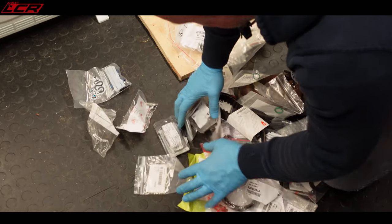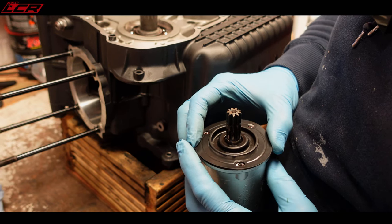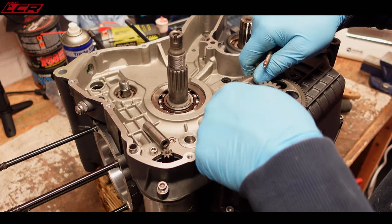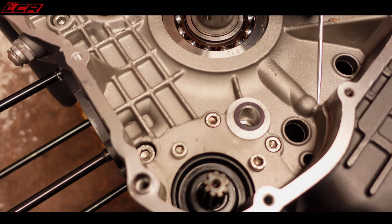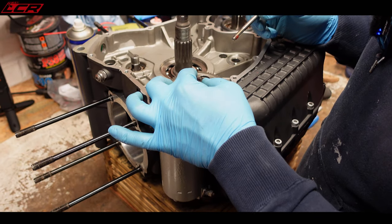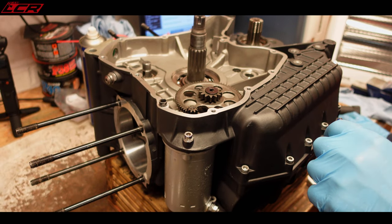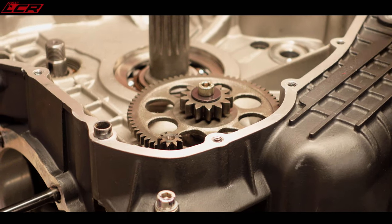We're going to stick in the starter wheel. This goes here and there's a little dowel that supports it - a shaft dowel. This is actually quite a large wheel and you'll notice in the casings there's a cutout for it. You have to line this up in the cutout first, then put the dowel through, and then we've got a washer that sits on top - that's like your spacer washer. Put a little bit of Loctite on there and set it in. Just going to check it turns down through its hole first before we do that. 10 Nm - it's done.